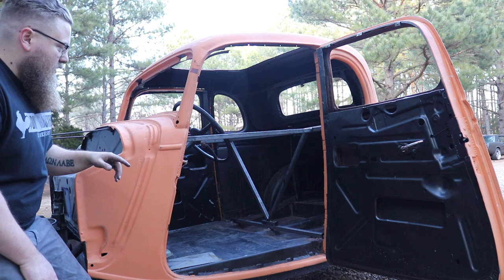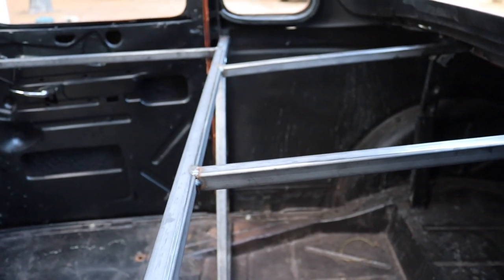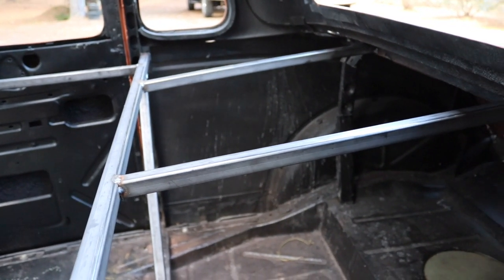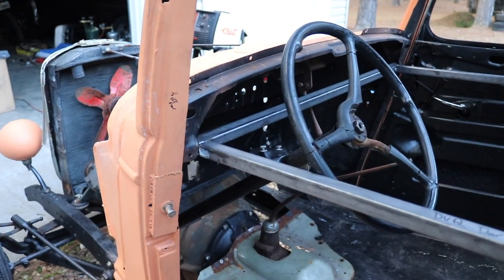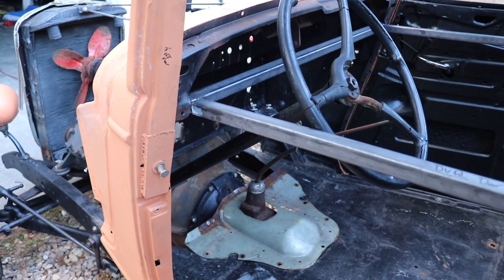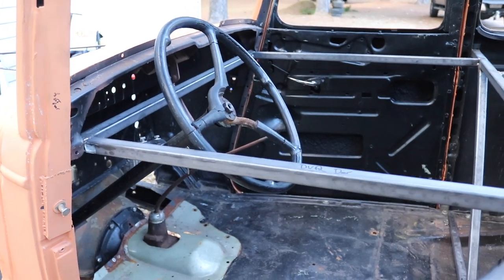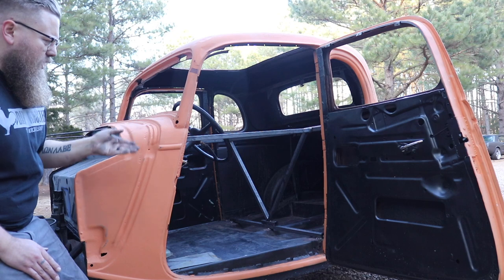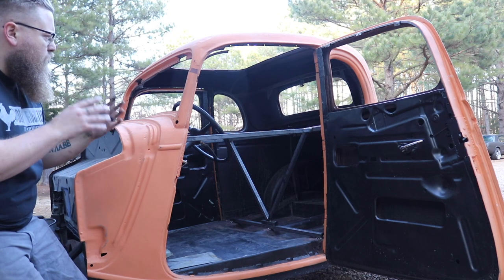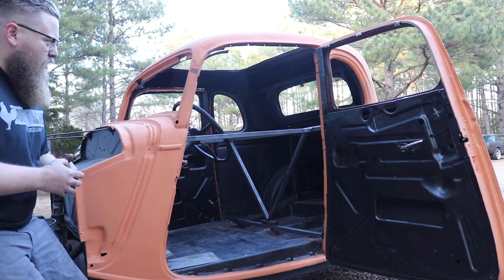Something to keep in mind if you're working this body style. But generically speaking, I also have from that crossbar on the top going to the back trunk area of the car. I want to make sure the body doesn't sag up or down, so that's why I have those crossbars continuing throughout the entire body — it starts at the dash, hits the center section, then goes back to the trunk. That's basically rigid front to back all the way, giving us the full structure of the roof to keep this cab solid when the roof is off.